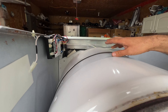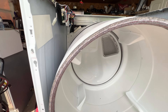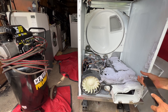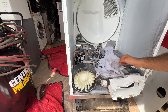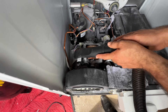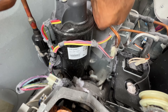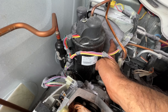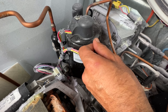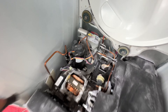Open the belt. Of course I have to tell you to disconnect the power before you work on it — but because it's in the middle of the garage it's already disconnected. You can insert your hand inside. Look at the thickness of the lint — it's too thick. This is also plugged. The only way you can clean this is to blow it with an air compressor. I'm going to vacuum it a little bit, but I really have to use the air compressor to blow all of that out. You can see how thick the buildup is here — not easy to clean with a vacuum from the back. That's why you have to open the dryer apart.